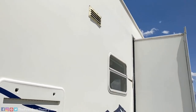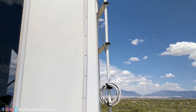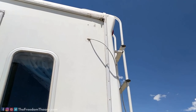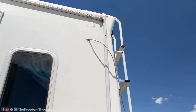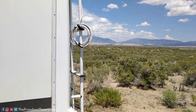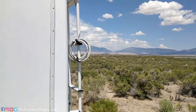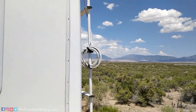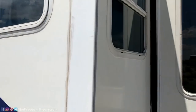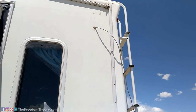This unit comes with 30 feet of RG6 coax. So let's go to the back of the RV. Back here I already have RG6 that I was using for the Drive 4GX RV, and there's a hole drilled through the wall already, so we're going to go ahead and reuse that hole. What I've been doing is taking the RG6 and Velcroing it to the ladder — that actually stays really well. My goal is to have minimal setup and teardown when we get into a location or we're getting ready to move the RV. We'll have the pole up there for the outside antenna, the RG6 running back here, and then going into this back cabinet we will have the booster and the inside antenna.